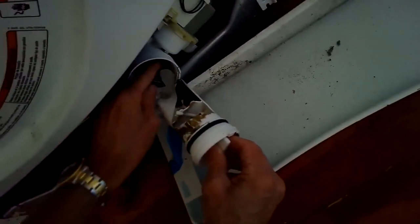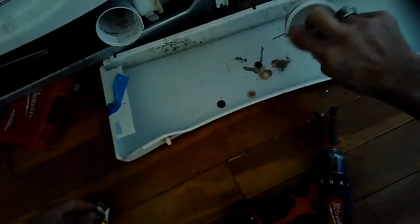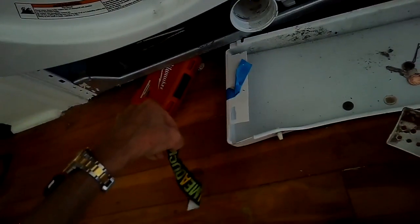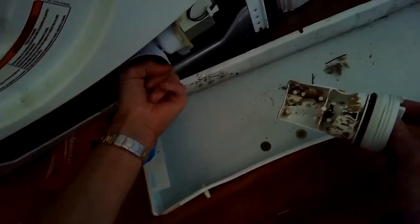So I just had a little water left in there, pulled the coin trap out, and then I noticed there's this big sticker that was in there and I think that was keeping it from draining. There's also some coins and bobby pins and stuff — that's normal. I've often found socks get pulled in here and cause it not to drain, especially small baby socks for a newborn — that's very common.